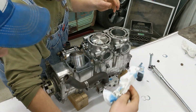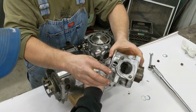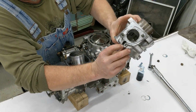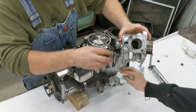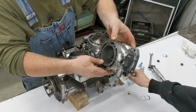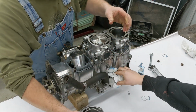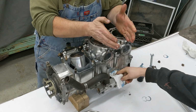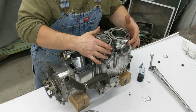This one I want to show you guys that we did go ahead and tap out his cylinders here. We tapped them out to a half inch MPT so we can do that water modification on the front of here, and the fittings that we intended on using is not going to work. I didn't take into account how close the cylinders are going to be together and the size of the fitting, so they're at least tapped.